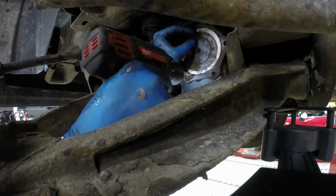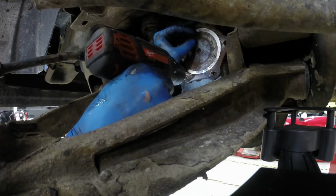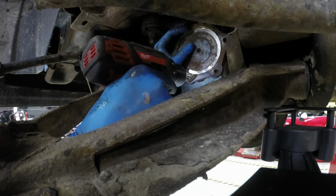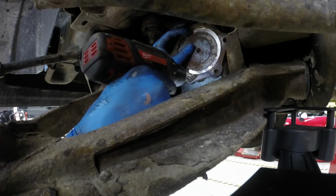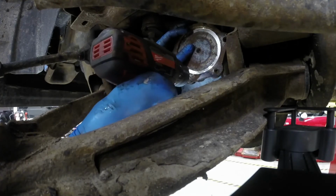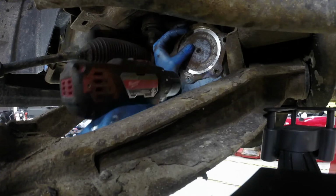So I'm using a 7/64 drill bit for a number 2 screw extractor. And it's a rather small drill bit. Usually I start out with a pilot hole when I have to do something like this. And that smaller bit makes it a lot easier to punch through, especially to keep centered in the bolt. So you start out with that.